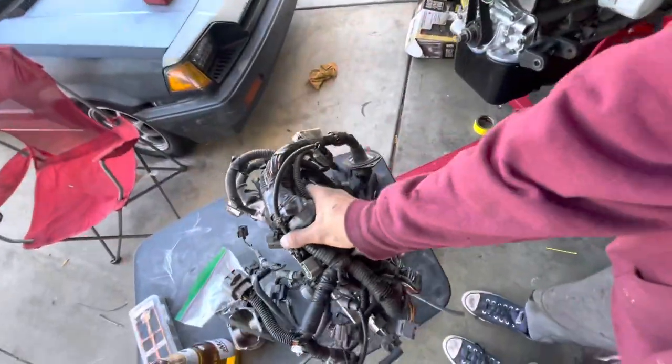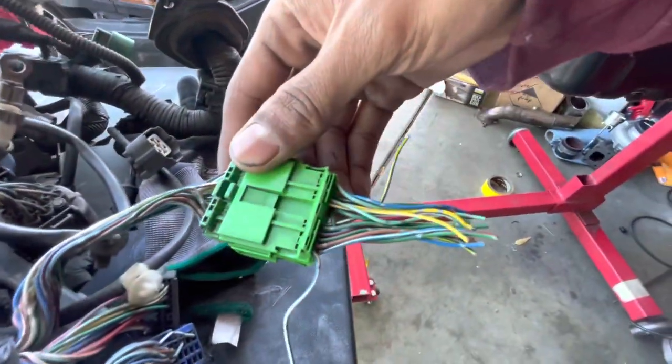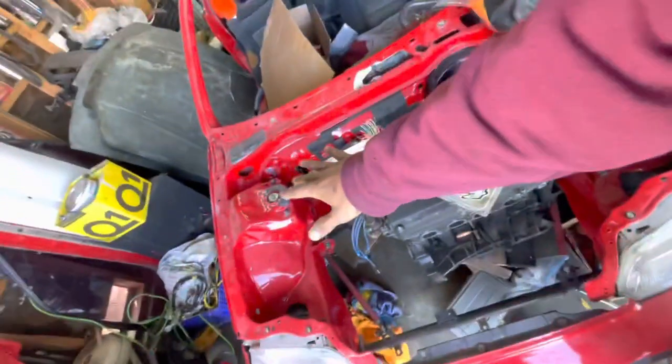At some point I met Thomas, and he told me the easiest way to get any Honda running — any Honda chassis, any Honda swap — is to get a 96 to 98 EK harness, which is OBD2a, and it plugs directly into the ECU and directly into the engine. All you have to do is connect a couple of little wires on the green ignition plug, and everything on your car will continue to work with no engine harness connected.